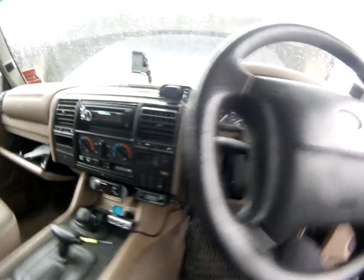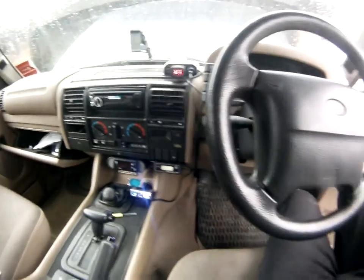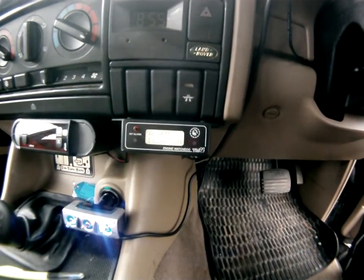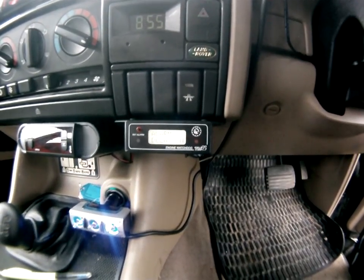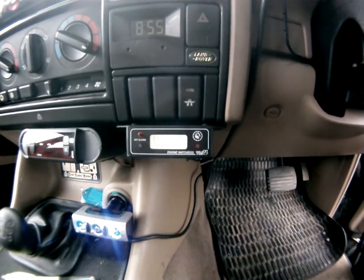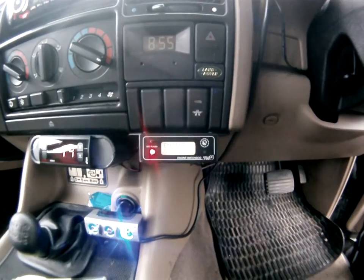So the way it works: I'll put the key in the ignition. I've set the temperature alarm at 91 degrees, and the delayed alarm is tied to the oil pressure unit — if I leave it without starting the engine, the alarm will come on saying low oil pressure, which is obvious since the engine's not running.